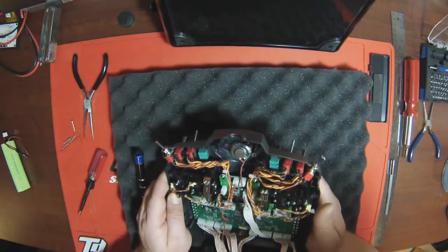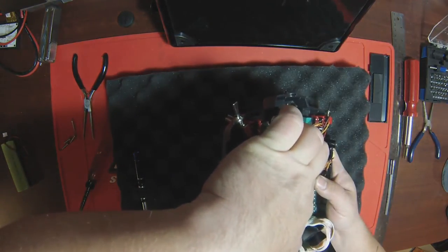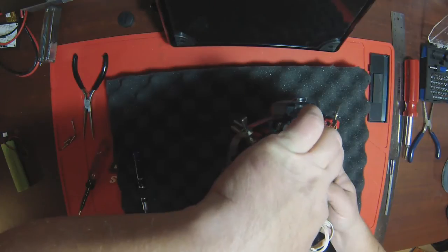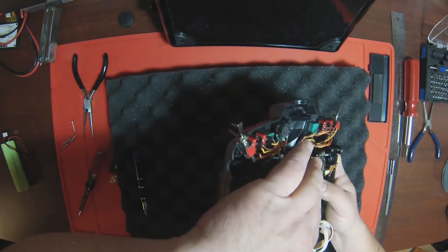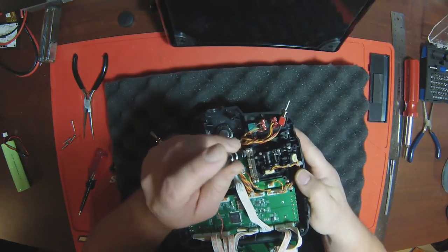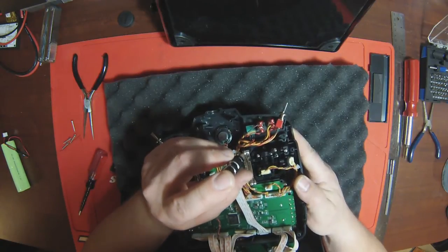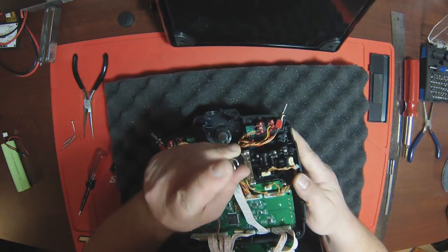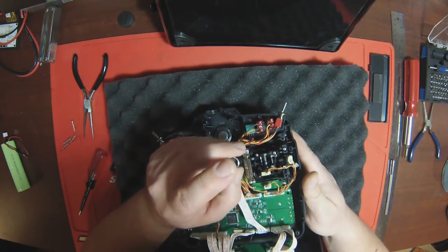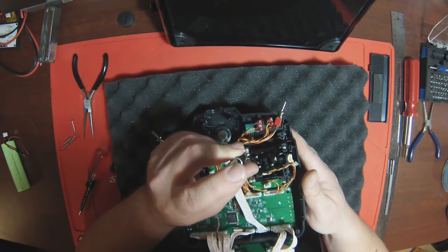Now to deal with the ratcheting motion. If you look inside the radio you'll see this bracket is what's giving the ratcheting motion - this piece of plastic is rubbing up against here which creates the ratchet. Technically if we loosen this off as much as we can until we get it to how we like it, just take your screwdriver and loosen it up. It only took me about three quarters of a turn and I've lost all ratcheting altogether. If I tighten it down I can start to feel the ratchet coming back, so I'm going to get rid of it entirely.